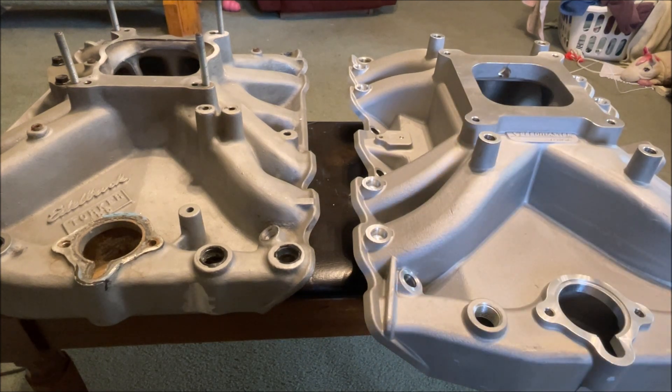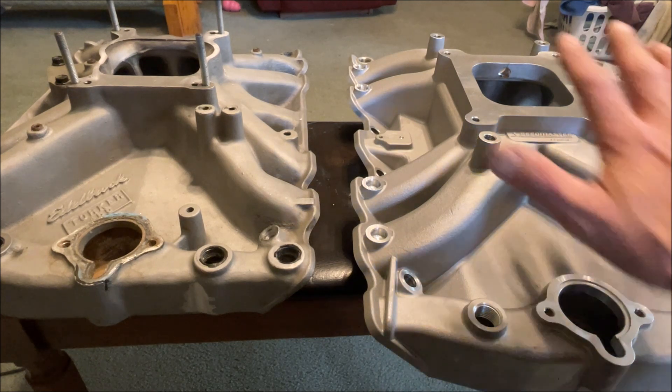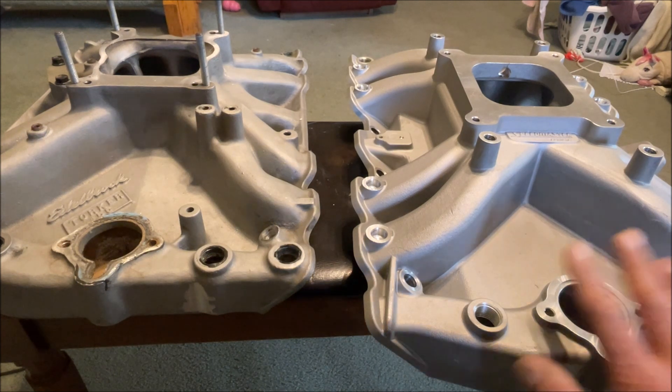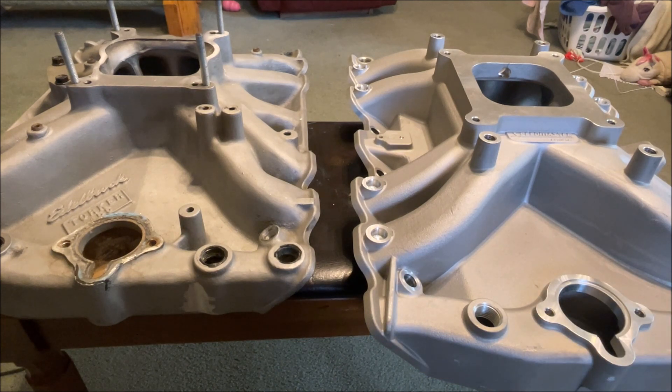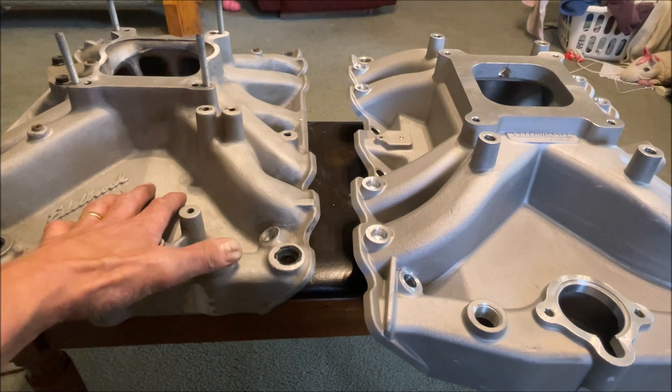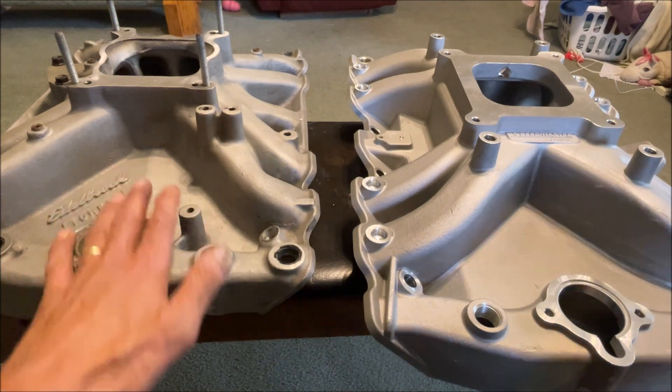I just wanted to show you this without saying it's definitively good or bad. For my engine build — Speedmaster heads that will be ported, with 2.07 and 1.71 inch exhaust valves, a hydraulic roller camshaft, a 482 cubic inch engine with a 425 steel crank offset ground for four and a quarter inch stroke, 7-inch long Chevy big block rods, camshaft specs of 0.605/0.609 lift and 249/254 duration, intake/exhaust at 50 — I'm going to go with the Torquer because the Siamese runners are scaring me, and we agreed it won't be beneficial.